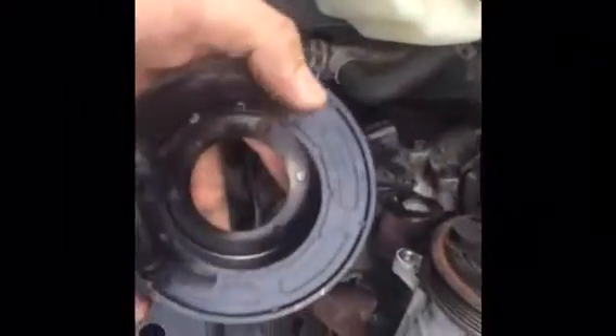I'm going to take that screw off in the middle and open it up — it shouldn't take too long if everything goes smooth. This here is the new part — this is what the clutch coil looks like. What happens is this makes a strong magnetic field, like a big solenoid. It's a coil, it makes a strong magnetic field, and then it sucks in the clutch.